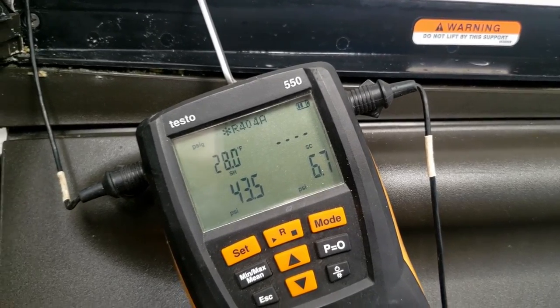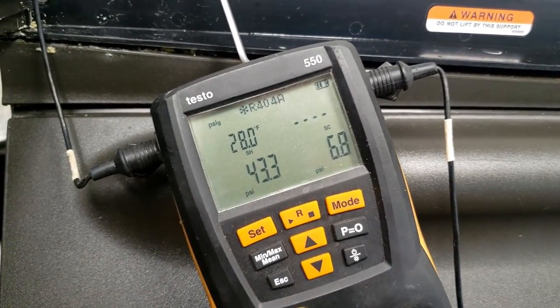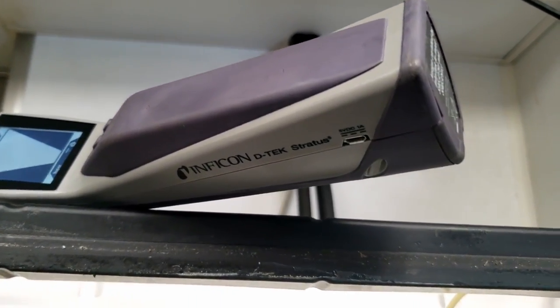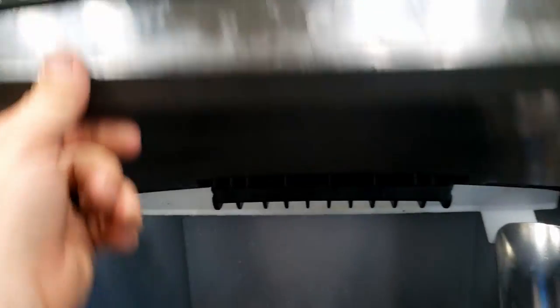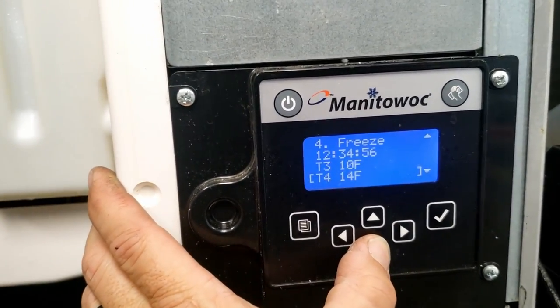If it ain't broke don't fix it — if it's not causing the malfunction, they're not going to want to change anything; run her until the wheels fall off. After adding refrigerant we're going to time it and see what we got — she just went into harvest. We'll do a scan with the Stratus, see if we can find a leak on those fittings or wherever it's hiding. A little more weight fell, a bit better — right at the minute 21 mark. We went ahead and emptied the ice out so we can see what we got. This is how you really want to test — you want all that heat blocked out as much as possible, technically with the door shut.